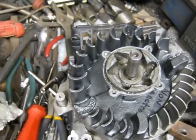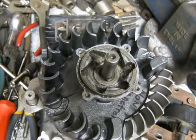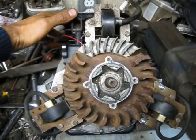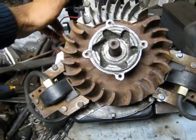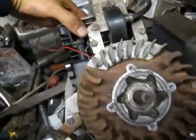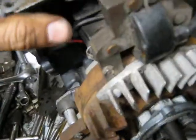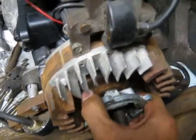I have the three coils mounted on the engine — magnetos, whatever you want to call them. The bottom two, cylinder number two and three, are Magnetron electronic ignition from Briggs, and I've got them grounded out. I just installed the top one. Watch this thing because the heavy flywheel wants to fall off the workbench. I'm running breaker points on the number one cylinder — I think it'll make it easier to start.